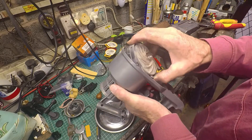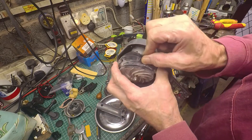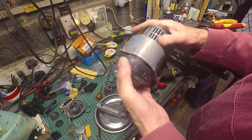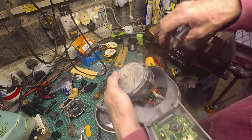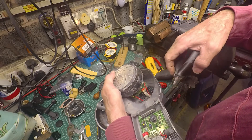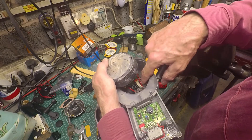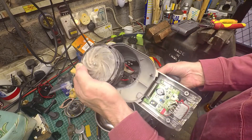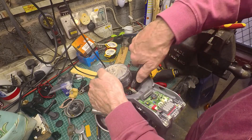It does just pull out — mounted in what looks like a rubber moulding that just isolates it from the plastic housing. And a little brushed DC motor. That's very interesting — there's the power straight from the battery, and there's this ribbon cable which comes back to here. And then there's two red wires which I hadn't seen before. Oh, this is the switch. So there's some sort of sensing going on through this ribbon cable.